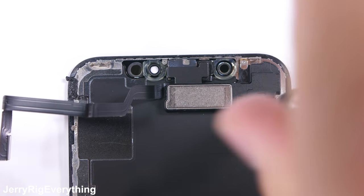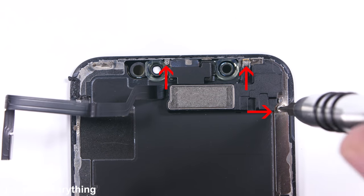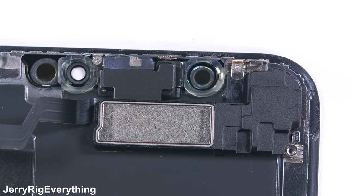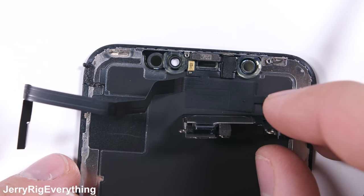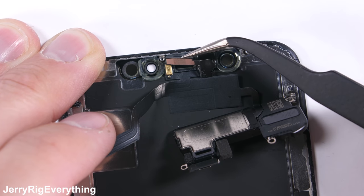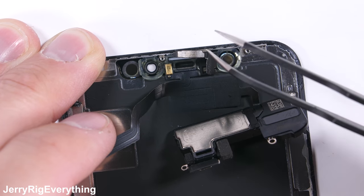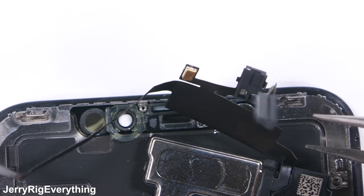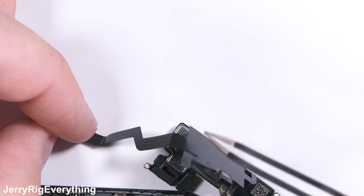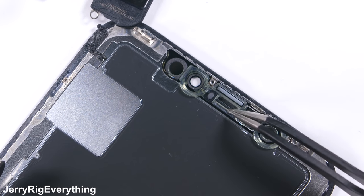The new screens will probably not come with the earpiece attached, so there are 3 more screws we need to transfer over. I'll pull these out being careful to keep track of the little gold niblet on the top screw. Then I can fold the speaker down and away, allowing me to pull up the microphone and the other small sensors. These ribbons are extremely fragile, so go slow and be careful. Depending on how the new screens ship, you might also need to transfer over some of the clear plastics, but that's not too big of a deal.